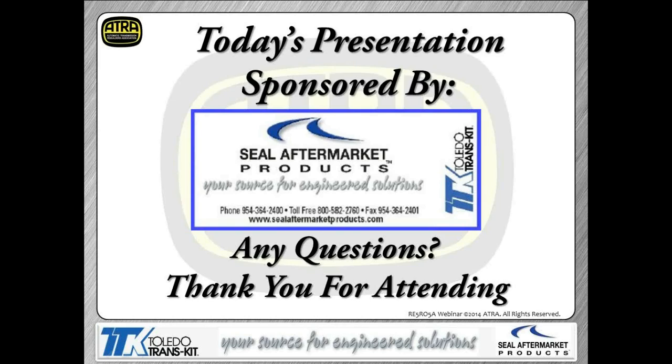Sealing ring issues on this transmission have been probably the biggest headache to date as far as tech calls go. We get several tech calls. A lot of guys don't want to use the aftermarket rings that come in the kit. The bottom line is the aftermarket rings are the same ones that Nissan is putting in their kits. The big issue here is not the rings themselves, but how they're handled.